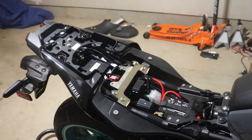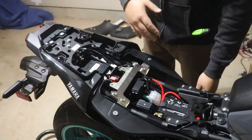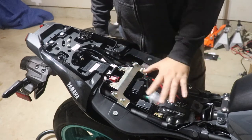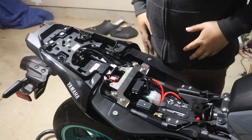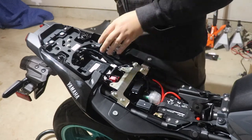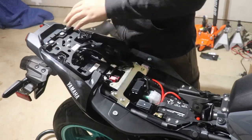As you can see, I already got the seats off. You just need to use the key that goes in here to unlock the passenger seat, and then there are two five-millimeter Allen key bolts here that hold the driver's seat — undo those and take it off. From there, remove this rubber piece. There are four 12-millimeter bolts here, and then you also need to get to these Allen head bolts with a four-millimeter.